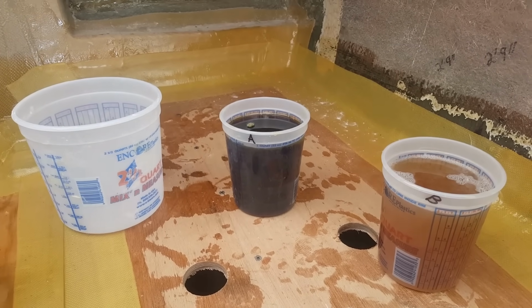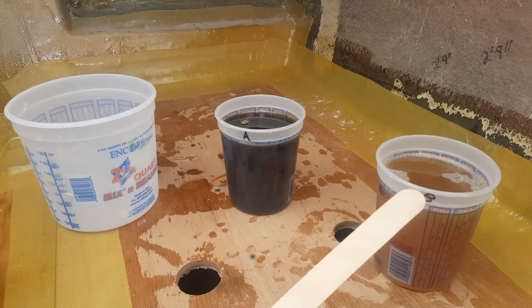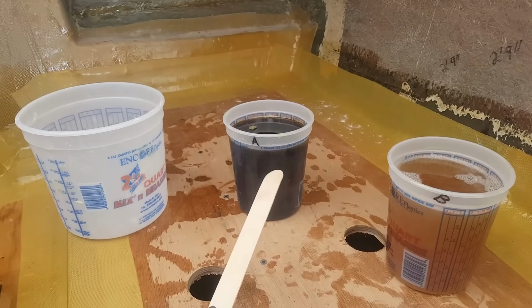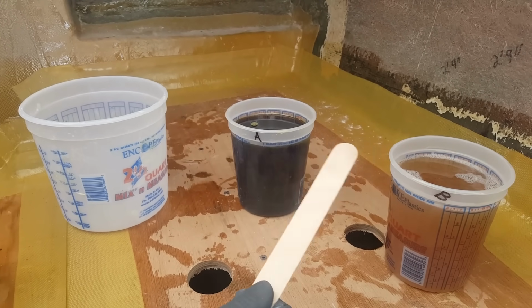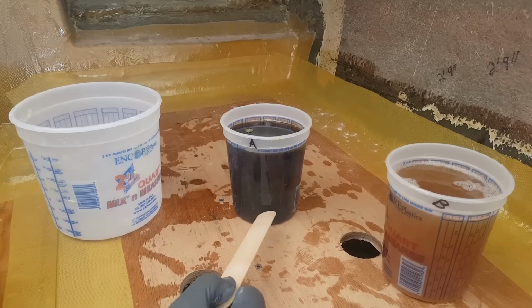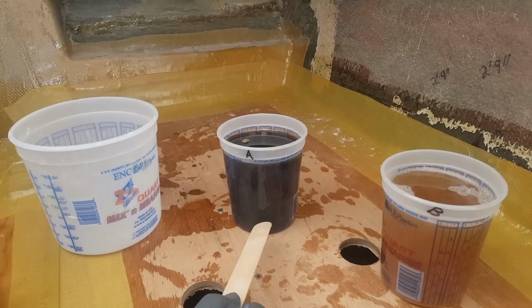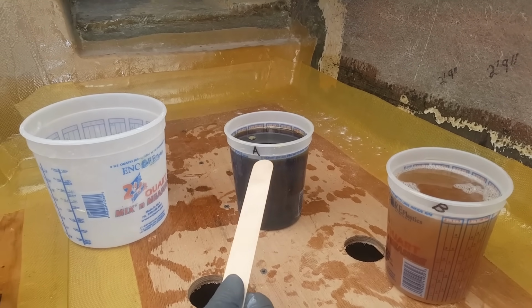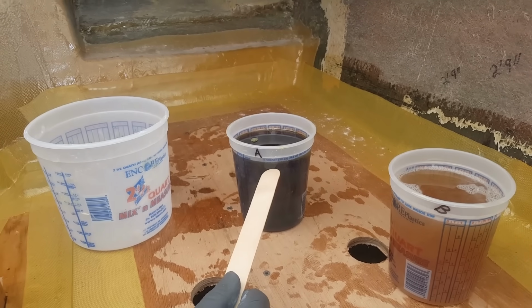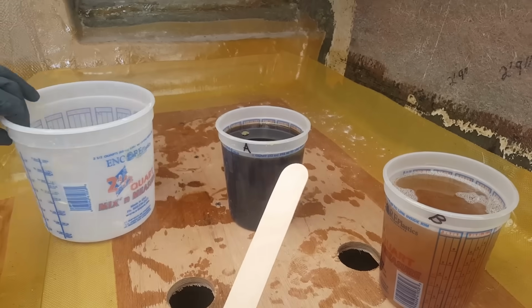All right, so another tip here is label your cups part A and part B. If you switch those, even though there's only going to be residual amounts of the chemical left over at the bottom, it will activate inadvertently if you forget. So mark it and only use part A for the entire boat moving forward. Same thing with part B.